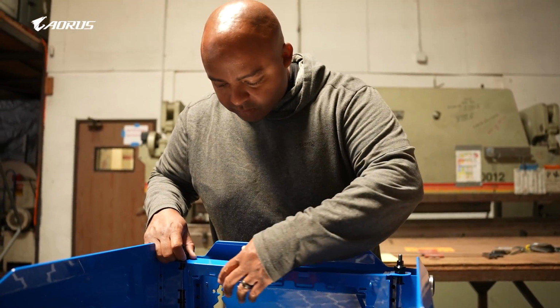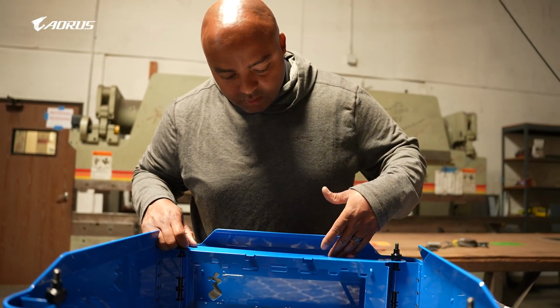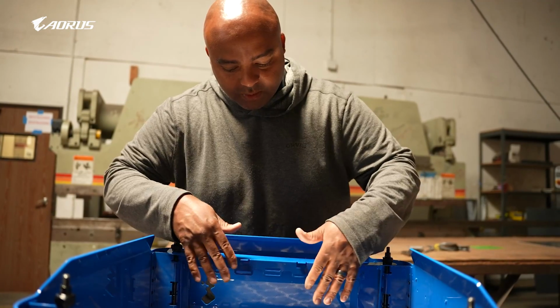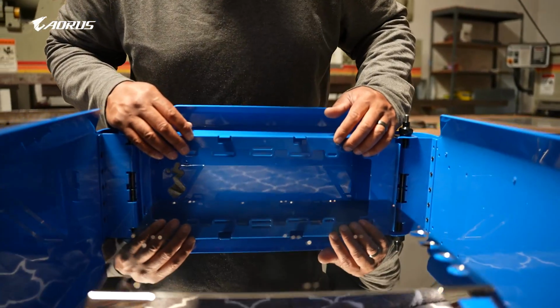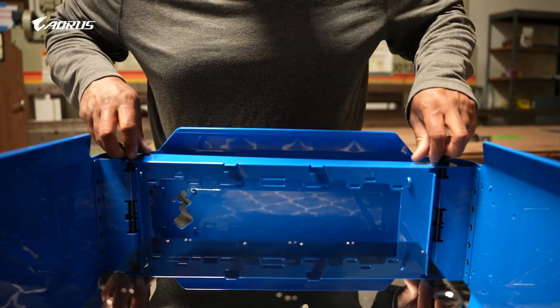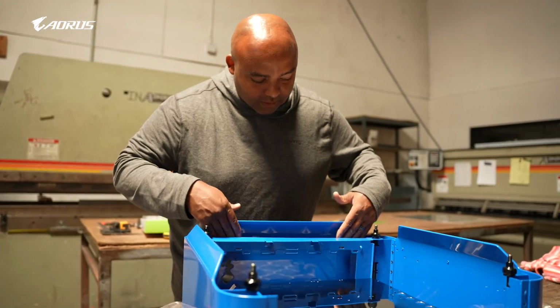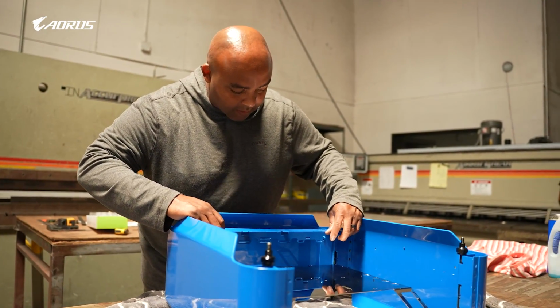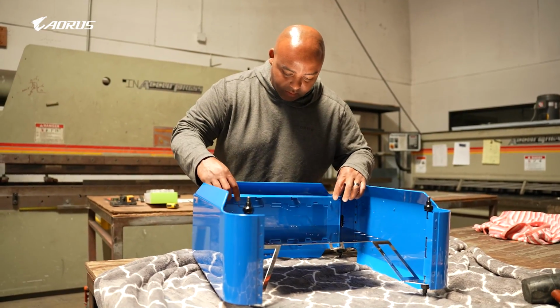Holds the radiator. Yeah, 360 millimeter radiator here. We'll probably do the fans on the inside, so we're just seeing the radiator sit here and not being distracted by moving fans or colored fans or anything like that. So the fans on the inside, radiator will probably be EKPE, which is I believe 40 millimeter thick, will sit here.